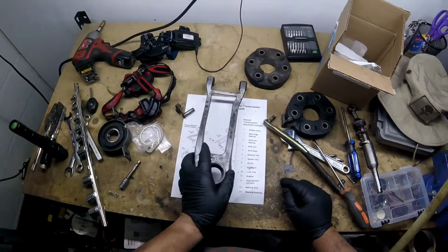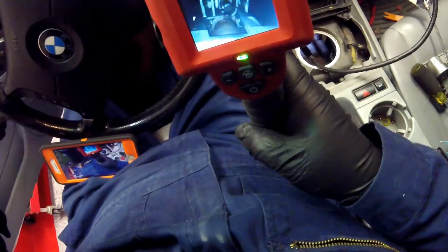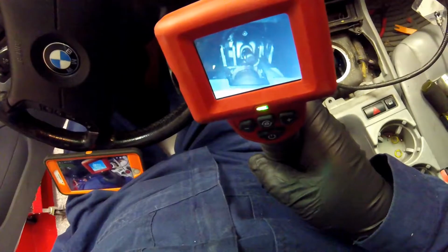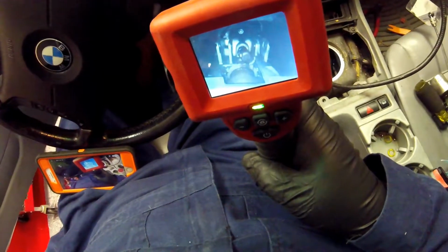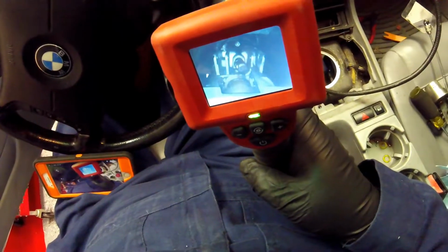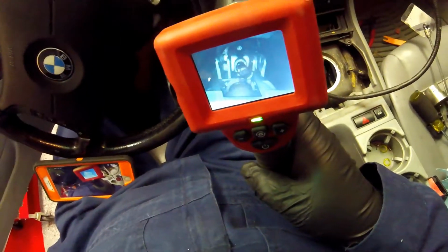But again, hopefully I captured all this. Okay, one more thing I forgot to mention. In here, you can see a pocket. It's like an open space with the cylinder there. My recommendation is to try to cover that up. I don't know why they leave it open like that. But the casing, you have to take apart the casing if anything falls down there and get to it. So the best thing is just cover it up with some cardboard, because you're going to be using small washers and small clips, and more than likely they're going to fall down in there.